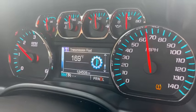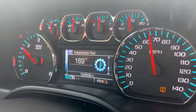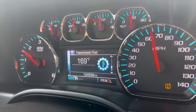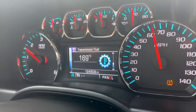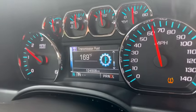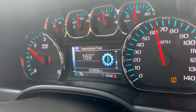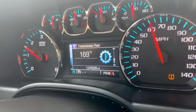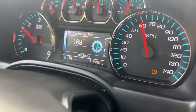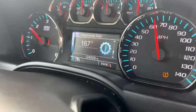This little kit I put in here is really cheap — it's just too cheap to be ruining your transmission by not putting it in. I'm going up a hill, so the temperature should raise just a little bit. We're probably as good as we're going to get at 169 — you're talking about dropping 20-something degrees off a transmission. Now we're down to 167. I thought it would raise going uphill, but it actually dropped.